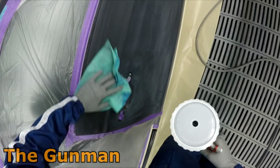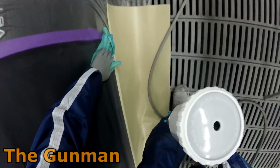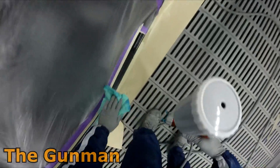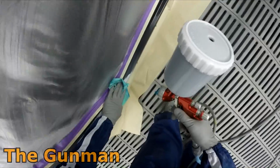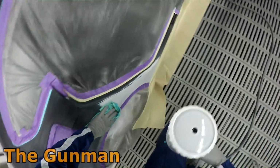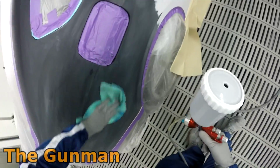Whereas I do know that the Axalta one, they recommend using the light, but that's pretty expensive. I've heard even around $10,000 just for the light to cure their primer. So it turns into a bit of an expensive thing when we can just use the Metalux one. And the primer itself is expensive. I wouldn't recommend it for everybody. If you're using waterborne, it may not even be worth it.